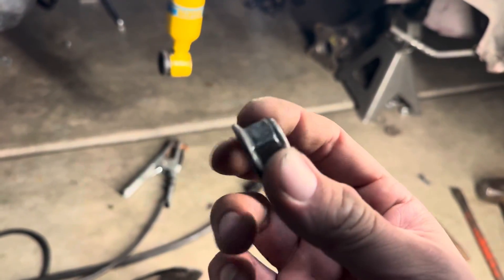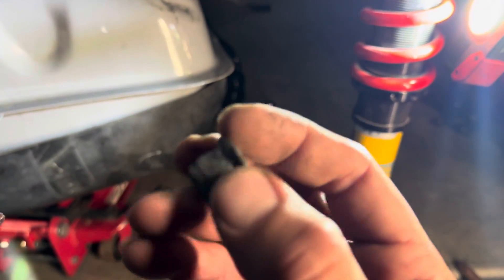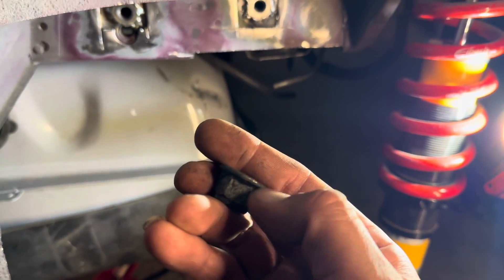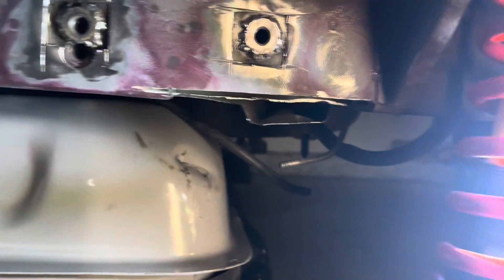Since I removed this layer — like I said it's double-layered — this plate back here that was already there, I cut this hole out right here with the cutoff wheel. It's double-layered, so you put it on the bench grinder and round it off, or drill a hole big enough to make it fit, and then pop the nut in there. This flange here is resting on that second layer right there — boom, it's resting on there. The thickness of the flange on the nut is going to sit flush because you cut this extra layer off. You'd think it would pop out further than the frame, but no — it's going to sit flush. You can fill the empty space or save the little pieces you cut out.